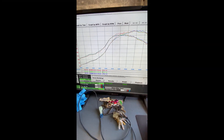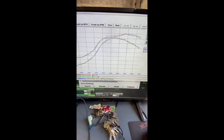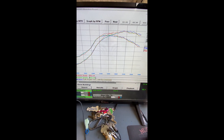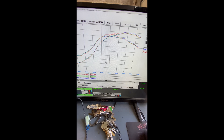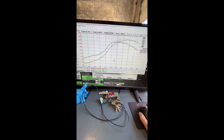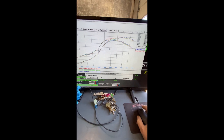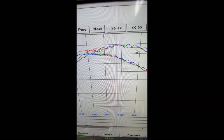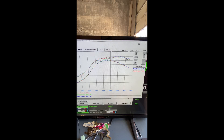All right, so we're looking at all three runs on Brandon's car here — pull one, two, and three all overlaid. Pull one is what it came in at. On pull two, I basically just tweaked the duty cycle a tad because it was actually overshooting its boost target and then catching itself up top. Since the new motor's been put in, obviously something changed in the plumbing. Whenever you put a new motor in, I'm always an advocate of putting a car back on the dyno and double-checking it, because you could fix a small vacuum hose leak and get a different result that throws the tune off. Power is pretty much identical through all the pulls, except the blue line is the last pull where I refined the wastegate duty cycle table and pulled the boost back down to its target.